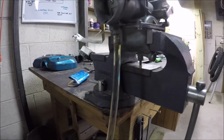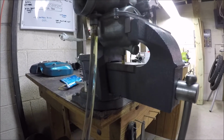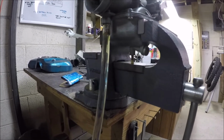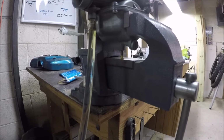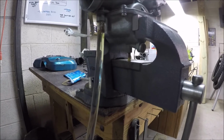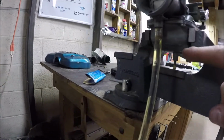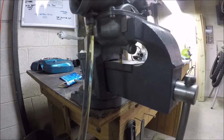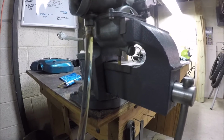I switched the float height to 27 millimeters. It was at like 25.6, 25.7 before. So I took a pretty big swing and set it to 27. Now, if it seats, that's good. I don't want to see anything come out. I did this last time, and nothing came out. However, if I go too aggressive, there will be very little fuel in the bowl. So when it's at higher RPMs and sucking a lot of fuel, there may not be enough in it to keep up those RPMs.